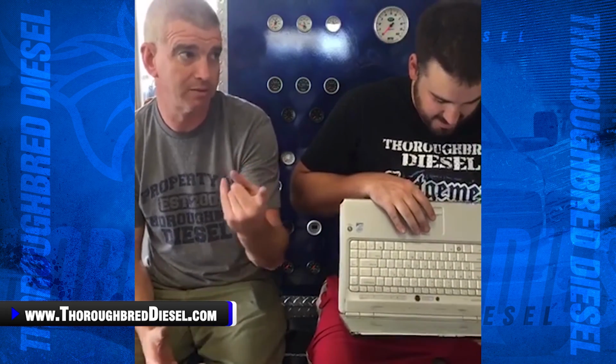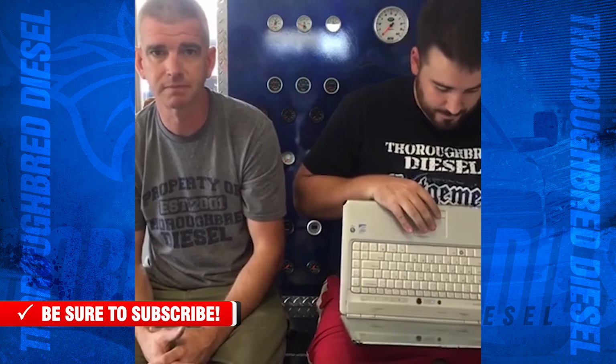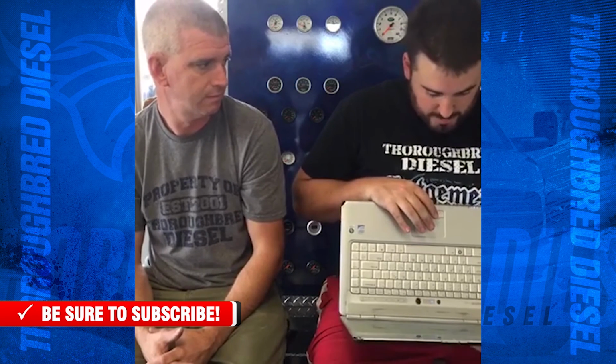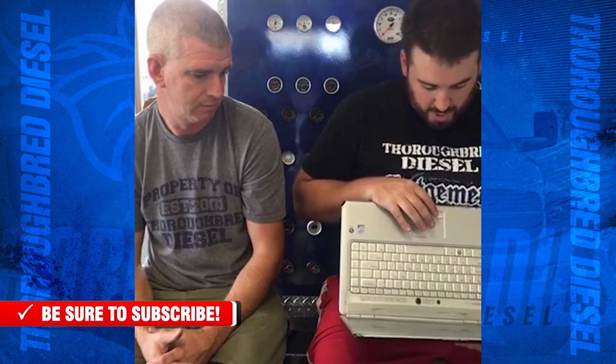All right. I have more problems with that. Zach Painter found out that my ECM has a short in it, causing my injection pump to have a delay, which doesn't turn on right away, making it crank for a while.